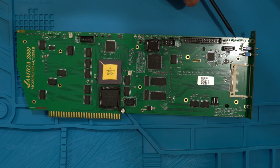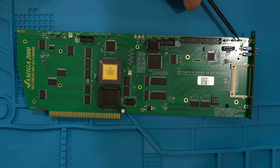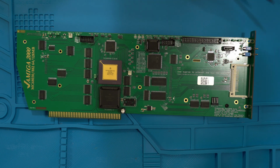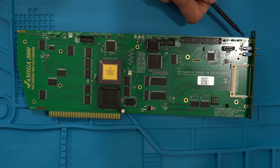And you'll have the cable select, which is similar for an IDE drive. So master or slave, you'll figure out by the cabling, depending on the position of the device on the cable, etc. And then you have the CF config jumper, which is going to put it in master slave mode. So I'm not sure, but that basically is for compact flash. You can have one compact flash being the master, and then a CD-ROM or another compact flash being the slave. But the thing is, your mileage will vary on that. It all depends. You have to basically trial and error.